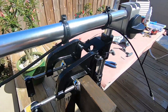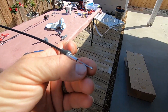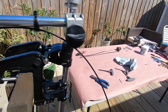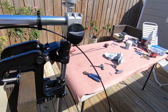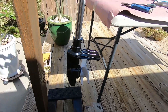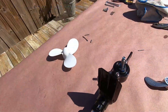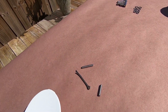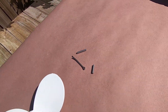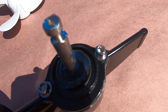On the upgraded legs, the Shimano shifter has been swapped out. You'll see the throttle cable, which is a Jaguar flex cable with billet ends — it has the tip that goes into the carburetor butterfly, soldered on. I took the kill switch off this one because it's going to be a remote kill switch, so no point having it on the tiller. I'm going to mount the motor, adjust everything, add the electric trim actuator, swap out the prop, do final adjustments, and finish the build.